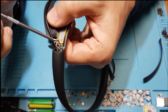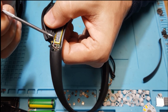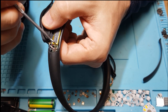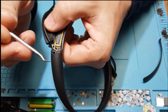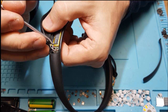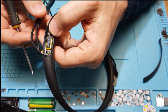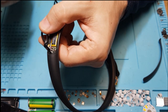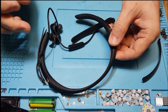All of these pins are covered in quite hard-to-remove glue. It's not simple stuff that you just pick off — this glue is hard and difficult to remove. I found it best to use one or two sharp tools and squeeze from two sides to remove it. You won't be able to solder through it, and if you try with a hot iron you'll contaminate the PCB and make things worse.